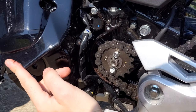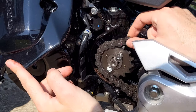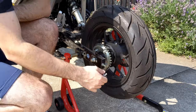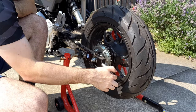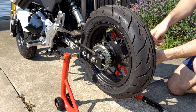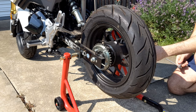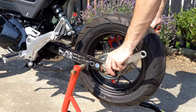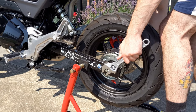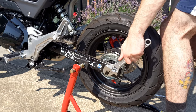The stretch kit comes with a new longer chain for obvious reasons, so I just bung this one in a pile with the rest of the standard stuff I've already taken off the bike. The chain adjusters had to come off next — a 10mm followed by a 12mm nut, just because the Japanese love using odd sizes we never normally use in the UK for some reason. There are a couple of well-torqued nuts to crack like the one on the rear axle, so make sure you don't rip the bike off the stands when loosening it off, but apart from that it's all plain sailing.